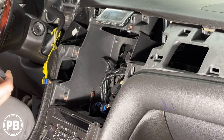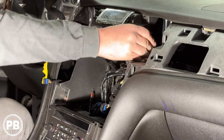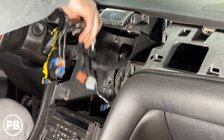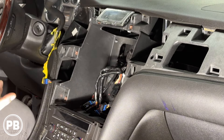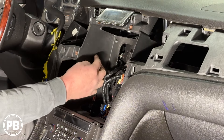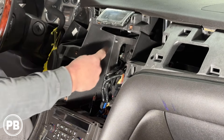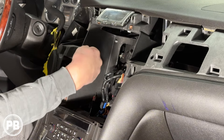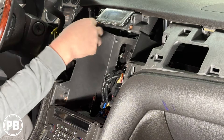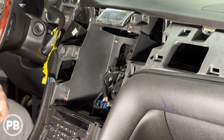Back here in the Escalade — there's just not a ton of space to install cables. This inner support piece keeps things rigid but is very limited on space for all our cables. There's already a ton of OEM cables, and then you add all our harness adapters — there's just not enough room to fit everything in. So we have a multi-tool and we're just going to do a little trimming on the inside. There's a ton of space on each side of our radio cavity, so we'll cut a little bit in — keeping some rigidity but just getting a little more wiggle room for harnesses.